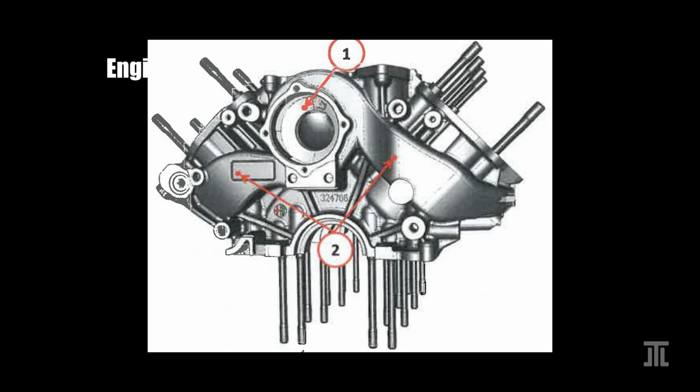The 690T also uses studs for fastening the bed plate and the engine heads. Studs are superior to bolts in many ways and are again found only in high-performance engines and the likes of old Rolls-Royce engines. While the VR's block is exceptionally strong, the Alfa's block is luxurious for its class.